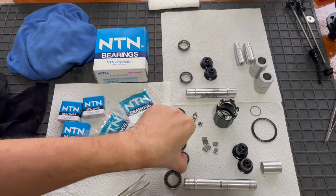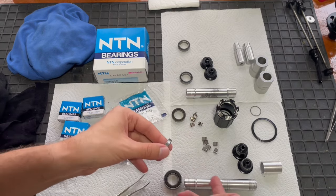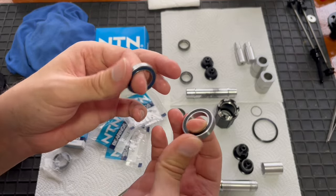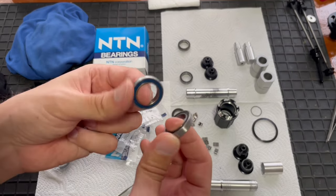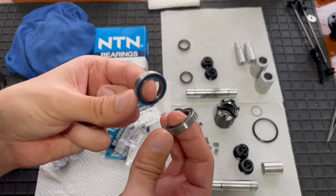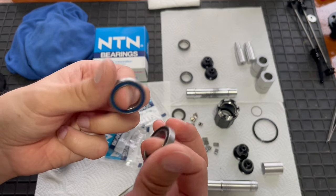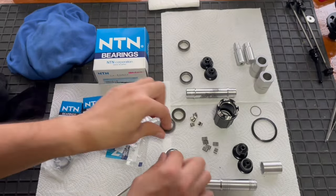The bearing that sits at the front of the hub body isn't actually turning properly - I can only get a partial turn out of it before it stops. Opening it up, it's gone rusty as well. There was plenty of grease on these, but I'll need to add more grease to the outside of the seals to prevent this. The two bearings at the rear of the hub body and on the main axle feel okay but are a little draggy and gravelly, showing signs of wear.